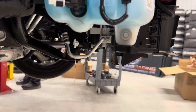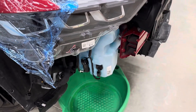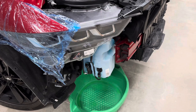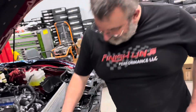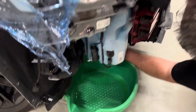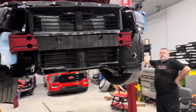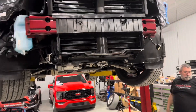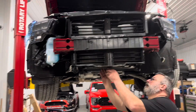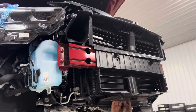You've got your little drain cock there — it's draining real slow right now, but once you take the cap off it should really start flowing out. Now we're cranking. Next step, the active grill shutters — those will be deactivated in the tune. Now, some cars that have radar for adaptive cruise and things like that — ours is a base model so we won't have that — but some of those, the frame will definitely have to go back in. We'll be taking a look at that.